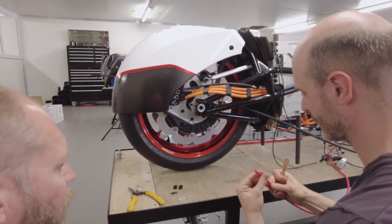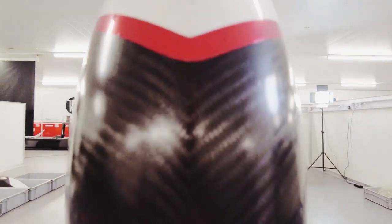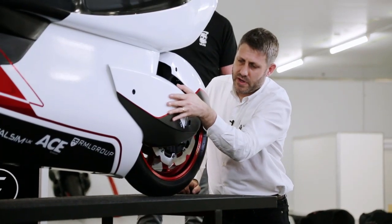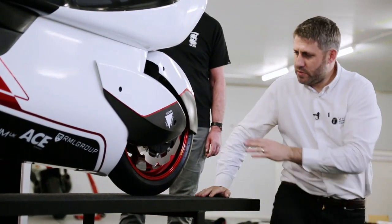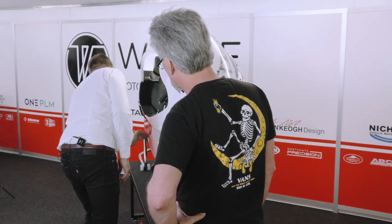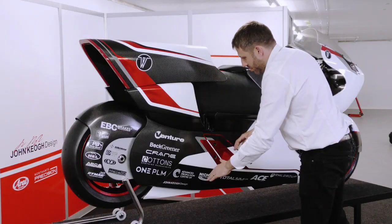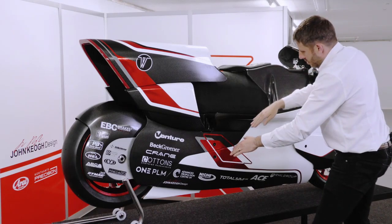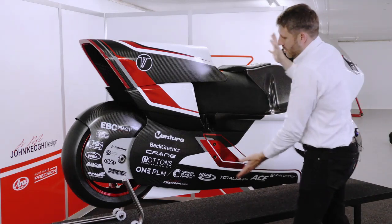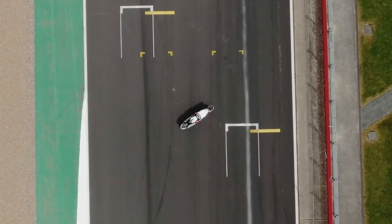With the duct itself, the multiplying effect of the benefit is how we end up at 70 percent. It starts with quite a blunt nose intentionally, to separate the air and run it around the front swing arm fairing covers. The important thing is on a superbike you would probably run the air down the bike, and at about this point here where your foot pegs would be there would be no fairings — all the air from this point onwards, perhaps diagonally up to the rider, would be seen as a low influence on the overall performance.